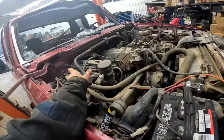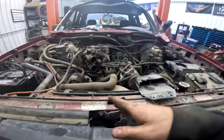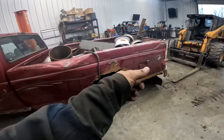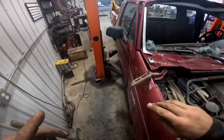I'm going to put this thing up in the air. We'll do the fuel system. We're probably going to put some oil in it. That might be why the thing's knocking. Probably doesn't have any oil in it, or if the oil is in it, it's probably not very good. We'll change the oil, delete the thermostat. In the process, I'll show you hillbillies how to make a mint hillbilly fuel system, because on every old Ford I've ever had, I either had one tank that didn't work, one tank that did, or both tanks that were so-so. I'll show you guys how to skate around that. You don't have to worry about having fuel tanks. All right, let's put this thing in the air.